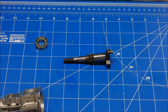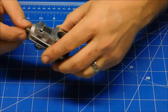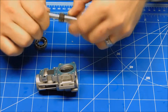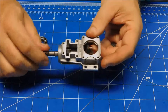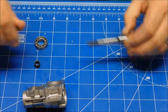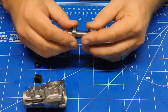I'm going to get ready to install the rear bearing now, so I'll put a little bit of oil on this crankshaft. I'm going to take that collar off — that collar actually provides the proper spacing for this timing gear to line up between that and the bearing. So that's what that little collar is for. This has finally cooled down enough, so I'm going to pull these guys off here and oil up my bearing real good to see how easily it slides on the crankshaft.